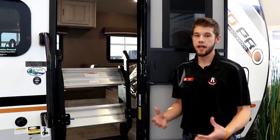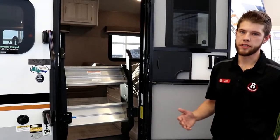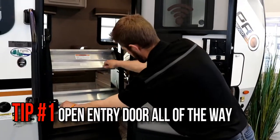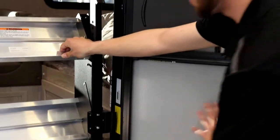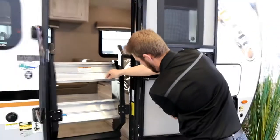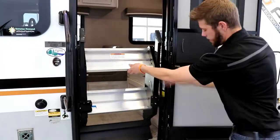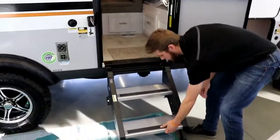The first thing we want to talk about, and it's very important, is make sure that your door is all the way open before you try and bring your steps down. If your door is kind of half closed and you're trying to bring it down, you risk damaging your steps or damaging your door — something you want to avoid. So let's open the door all the way up. Got our little release here — we're going to let that go and as you can see it's going to clear and drop right down to where you need it to.